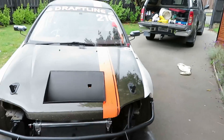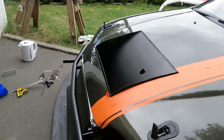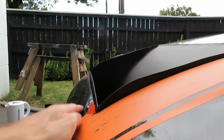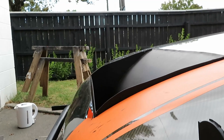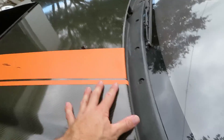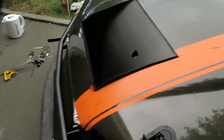The duct is curved as nicely as it can get. If I shut the bonnet it gives you a bit of an idea how it blends back in. I've left this small gurney flap here — that just kicks air up and helps create a low-pressure zone, which is exactly where you want to dump air. You never want it dumped into a high-pressure zone. You always want the vents towards the front.